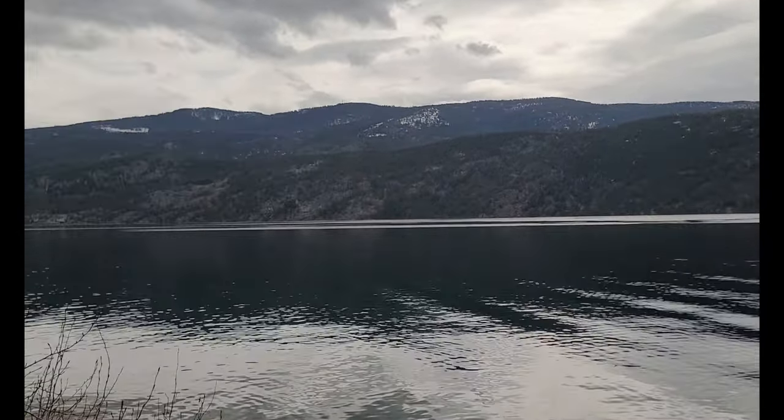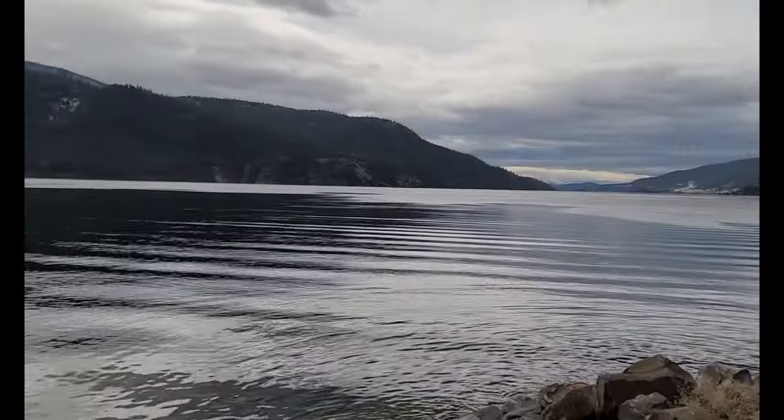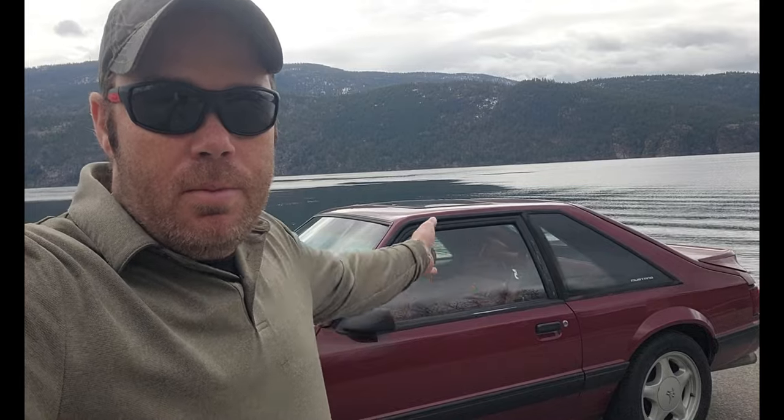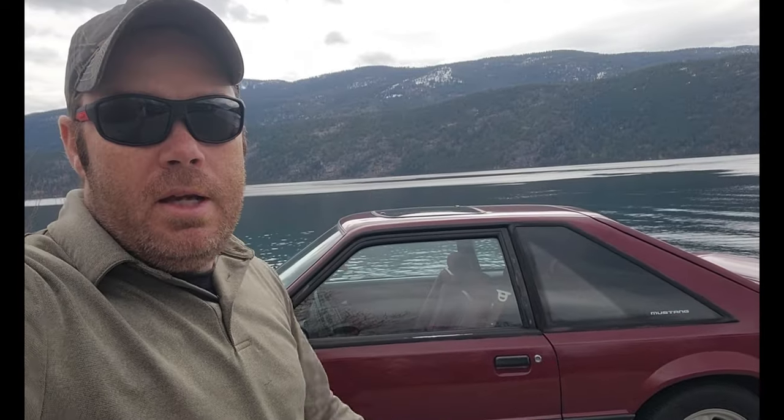Not a bad Sunday drive. If you remember from my last video, I was having drivability issues which were attributed to my spark plug wires and distributor cap failing. We got that taken care of and it purrs like a kitten now. The only thing now is we've got a stuck or bad valve - we're burning some oil, not a lot but enough that it's irritating. We're going to have to do some head work on this thing eventually, which fast-tracks something I wanted to do down the road with the bottom end, but it is what it is - it's a 33-year-old car.